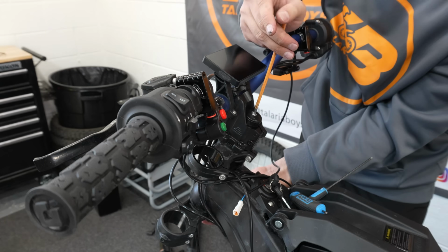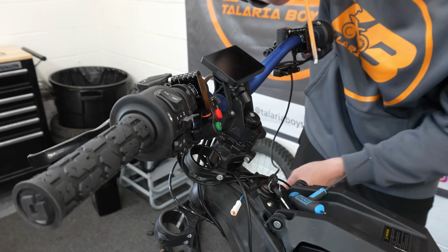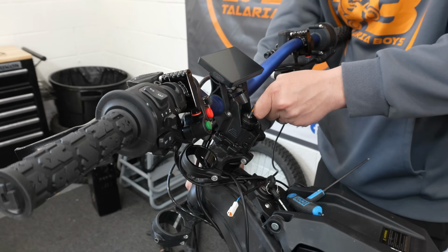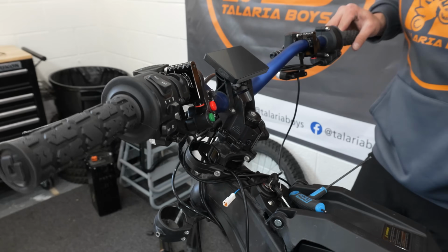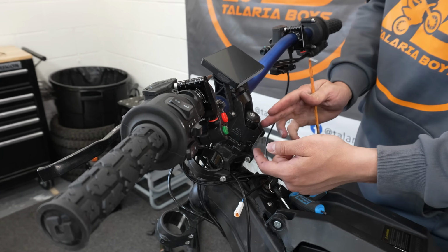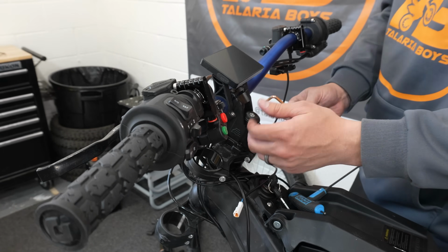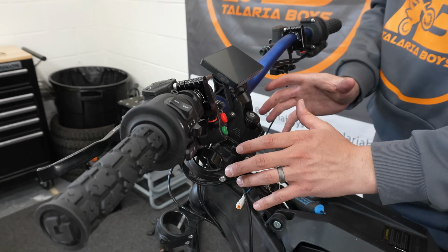Now, once you tighten your stem lock, that's what essentially holds everything together. It's what compresses your bearings. So we're going to go ahead and just tighten that up. You don't want to go real tight. You want to make sure your steering still feels good. You want to make sure these legs are essentially lined up best that you can. And then we don't need to tighten these other bolts yet, because we can adjust the play in a second once we get our legs back in.